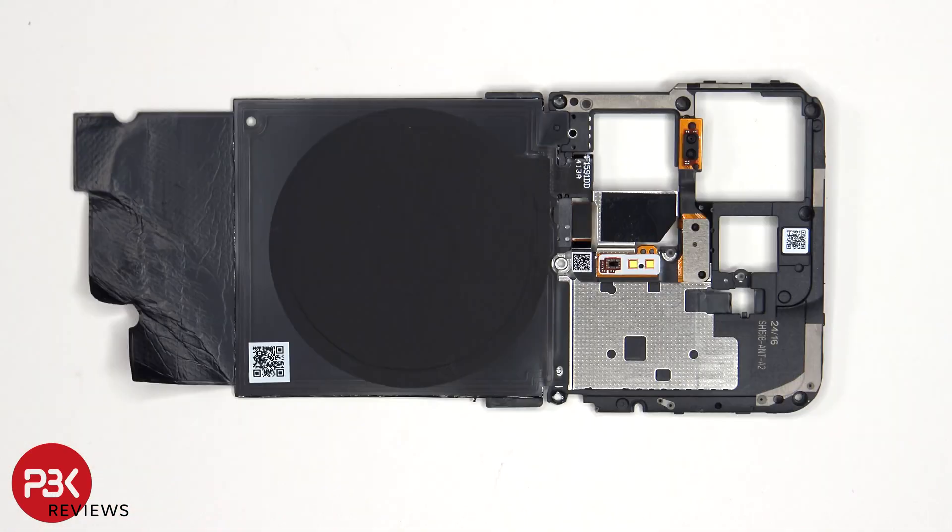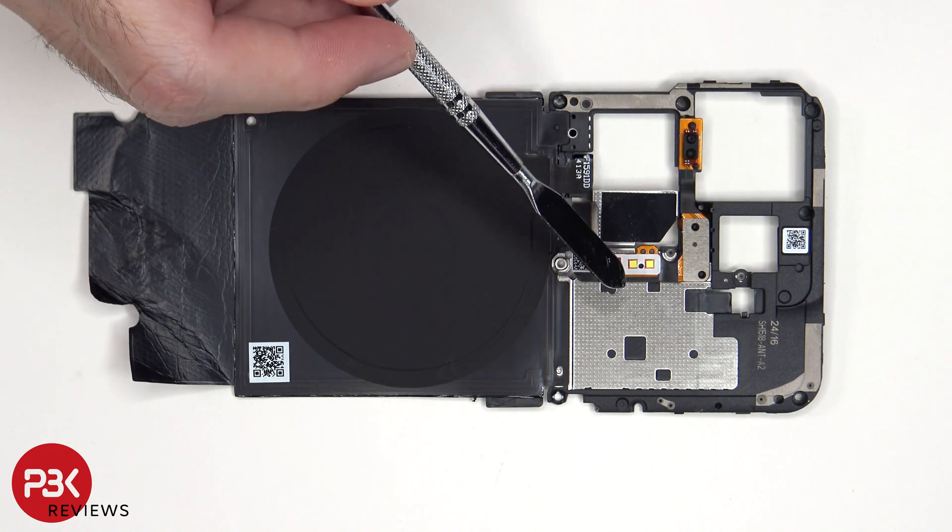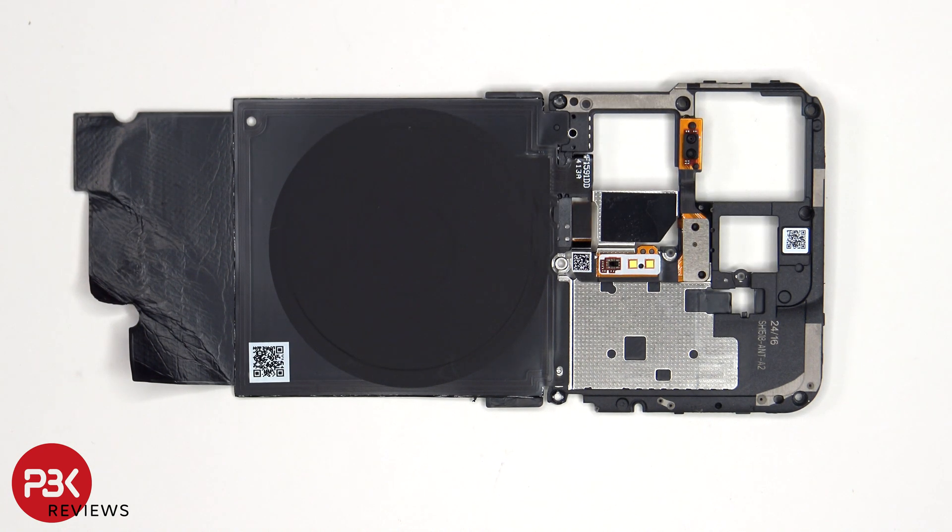Taking a look at the top plastic cover, we see antenna lines drawn in light gray, this flex cable which has the laser autofocus, the dual LED flash, as well as the 3-in-1 sensor which is for exposure, auto white balance, and flicker.